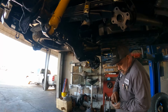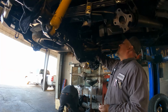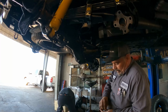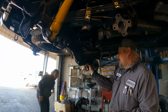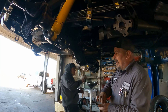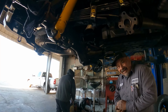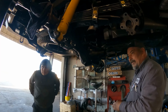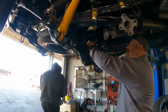All right. Washers. So he already put the gasket stuff on there? Yep, it's already on there. Cool. Now we tighten this thing down, it's gonna make its own little bead and seal itself up, and I could throw oil in it right away and it's gonna hold it. You can actually put the oil cover on there without bolts and it'll stick. Sometimes they come back to us because they want another service, and we're over here fighting, peeling that cover back off because of that silicone. That thing is no joke.